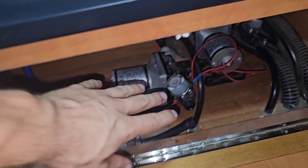...that you've had it connected to mains for like a month, maybe like a year, somewhere in between — usually two months or over. There's been back pressure from the mains connection, fairly high pressure, and it's been so long that the actual grommet thing that stops water flowing backwards is sealed — stuck — and it can't push through from the tank water. It's trying to pull as hard as it can but it's closed because it's been pushed closed from the mains for so long.